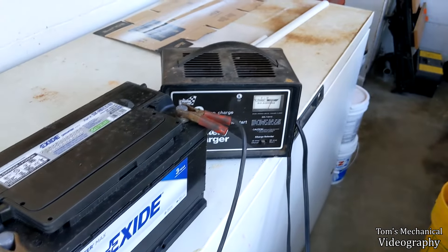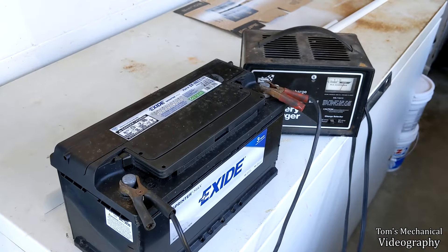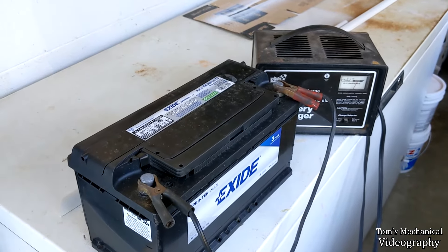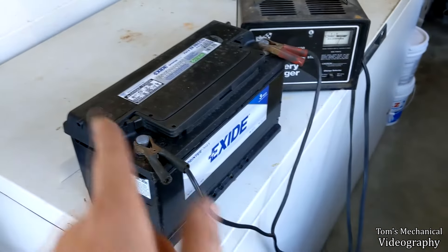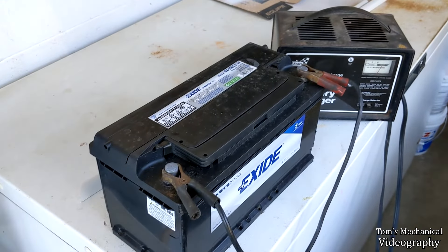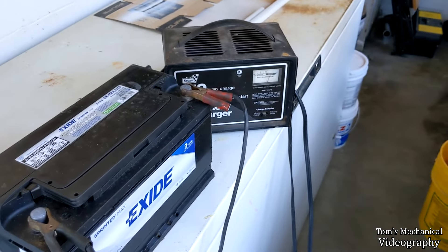The way to confirm is to pull it off the battery charger and check it with the voltmeter and make sure it is above 12 volts. If you really want to be sure, leave it for 12 hours and then check it with the voltmeter. Because when I pull this guy off, the voltmeter reads dead on 12. And when I put it in the car, the starter goes click. Yeah. You can't always trust the voltmeter.